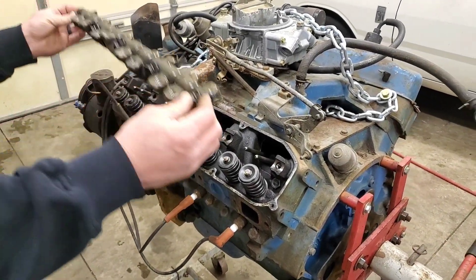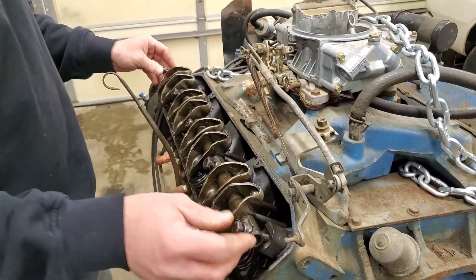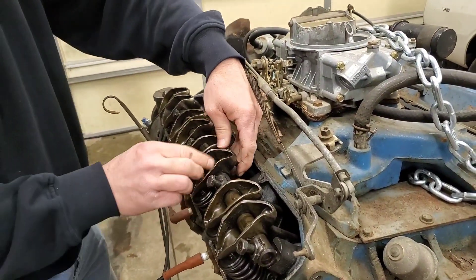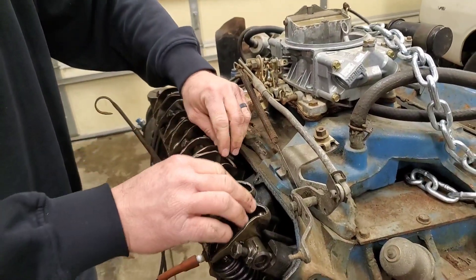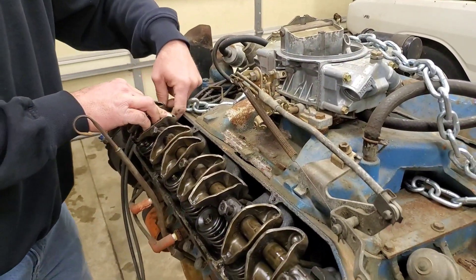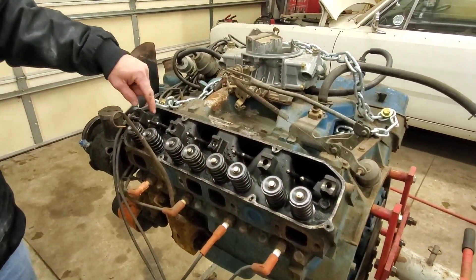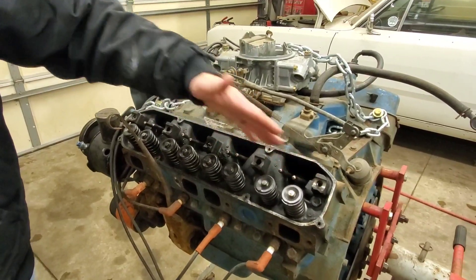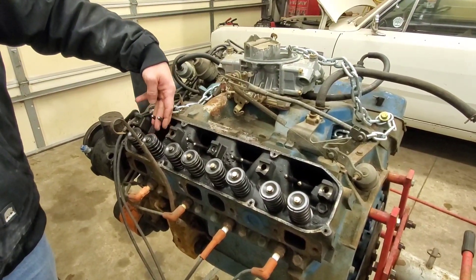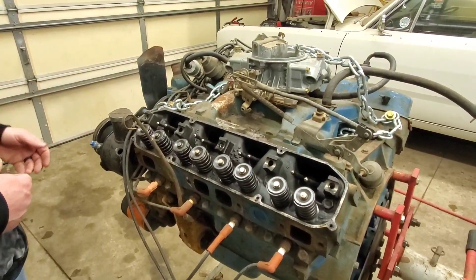Has this ever happened to you with your shaft mounted rockers on a Chrysler small block or big block? You try to feed all the push rods into the appropriate pockets on the rockers. You look at where the push rods are sitting in the lifters without the valve train, and you'll notice they sink down even with the pedestals for the rocker shafts. Obviously when you try to put your rocker shaft back on, you're trying to basically hold the push rods up for every single one of them. Either you find a friend that has seven hands, or...